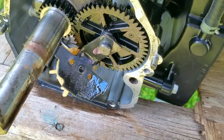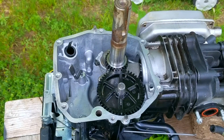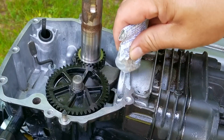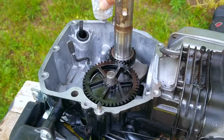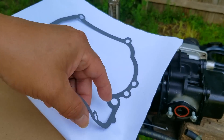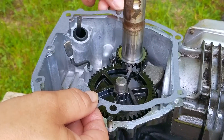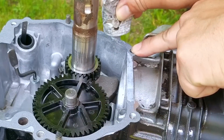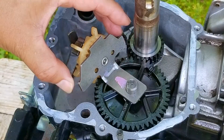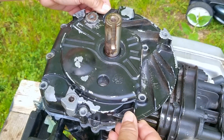So here's the bigger concern — why did the gasket break in the first place? The spacing for the bolts is rather far apart, and unless the gasket is sealed or glued in place it's going to eventually fail and blow out. To prevent this from happening again, I'm going to use some RTV to help seal the gasket to the mating surfaces between the bolts — only in certain spots, not everywhere. The paper gasket was not high density — at best it was medium density — which means even though it's incredibly thin it will break down and blow out again in the future. This is basically a timer for a catastrophic oil leak that could have been avoided by using slightly heavier paper, but someone at corporate had to save a few dollars. Penny pinching at its best.